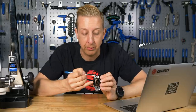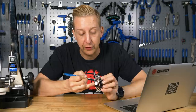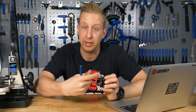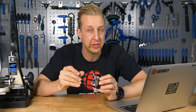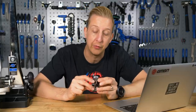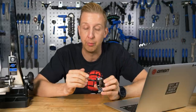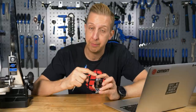If you have any sort of sticky pistons at home, the way to cure this is to get those pushed out and basically lubricate, or at least very much clean, the surface of the piston. A good thing to clean it with, if you've got mineral oil brakes, would be mineral oil, or brake cleaner. Make sure they're nice and clean, because those pistons retract, and if they bring any dirt back inside there, it's going to affect performance long term. Then push them back into place.